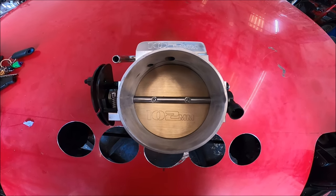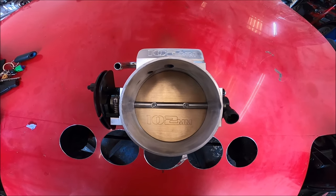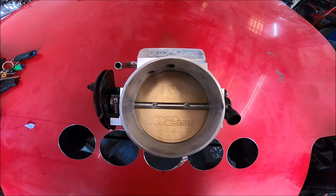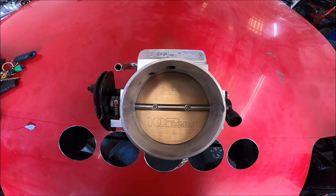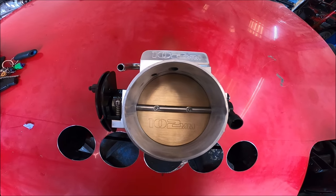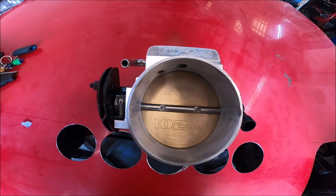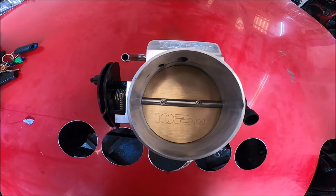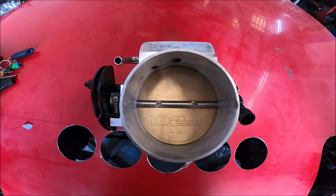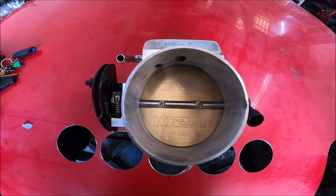So it's got no work to do. There's literally no airflow, so the motor is now unloaded, and that's why you hear it speed up. Because there's no air to suck in, the electric motor has got nothing else to do. On an engine, that again means there's no work to do. The turbine, the entire turbo basically, the turbine's got no work to do, the compressor's got no work to do, so it either speeds up or doesn't slow as fast.